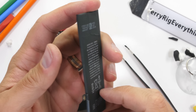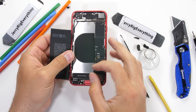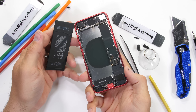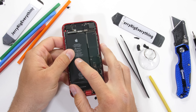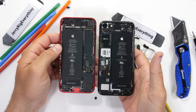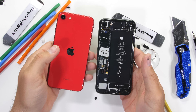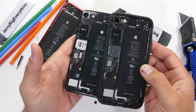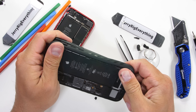This battery is a rather tiny 1821 milliamp-hour. Now that we have the battery out, we can see that the internal frame of the phone is metal — and as we know, metal isn't very see-through, which makes a transparent iPhone SE pretty difficult. For the teardown skin, we mirrored the internal image so that when looked at from behind, everything lines up exactly where it should be inside the phone. We even ripped off the metal plate covering the A13 processor so we could see the brains of the operation. I'll leave a link for my teardown skin from dbrand down in the video description.